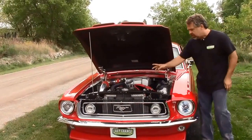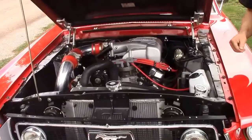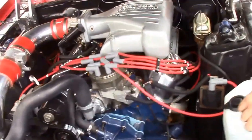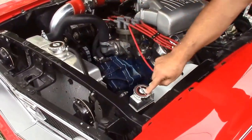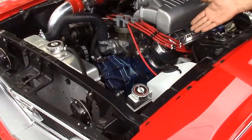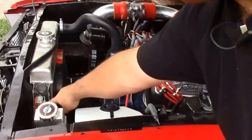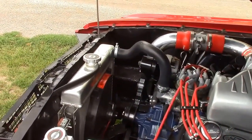In terms of cooling, we've upgraded. Now we have a three-core, top-of-the-line fully aluminum radiator. On the side you've got the coolant overflow, which is also aluminum and the caps are upgraded to match. From the side you'll see the electric fan, and we have a thermostat here so it's automatically going to control the fan on and off whenever you need to.